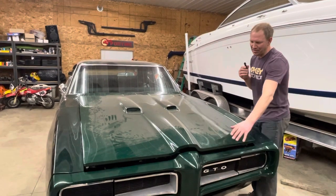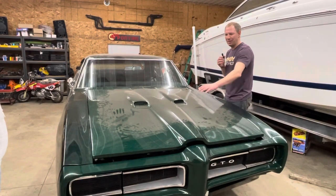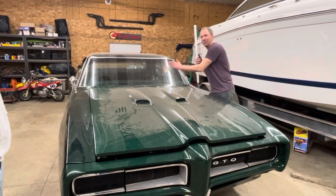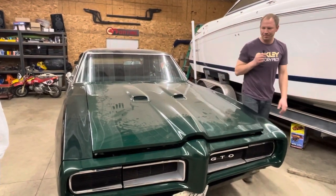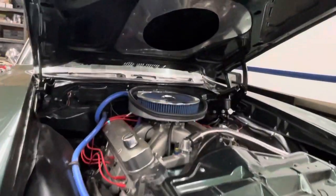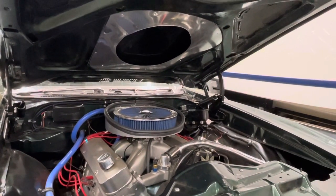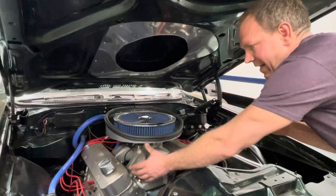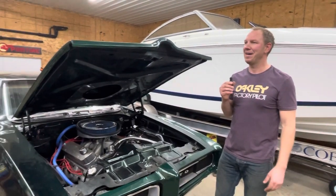They say you can get the ram air effect up there — air kind of floats around and maybe pushes off the hood, and there can also be backflow around there. That's why a lot of cowl induction setups pull air from the back. Overall this turned out really well — just a custom cold air intake, and as everyone knows, cold air makes horsepower. It's much better than breathing hot air off the motor, and it looks cool.